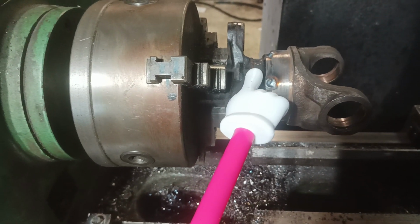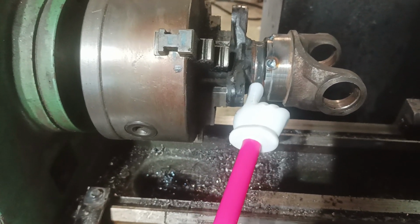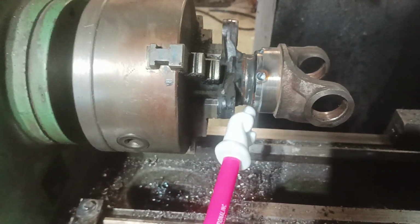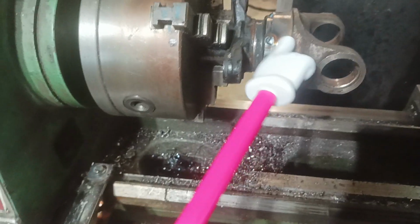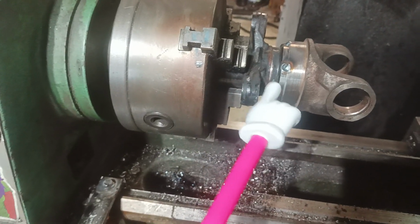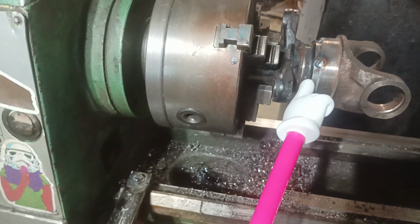You can see the little bit of a spot weld there. So once we get this welded on, we're then going to grind into here and weld it all up, and then we're going to weld it all here. And we'll probably do about 4 or 5 passes all the way around, so we have basically a connection of weld and not relying on this thinner piece of metal, although it is about a 1/16, which is sufficient for driveshaft material.